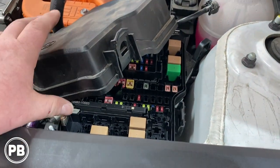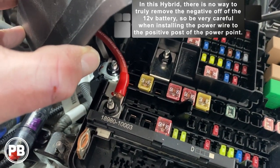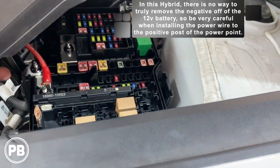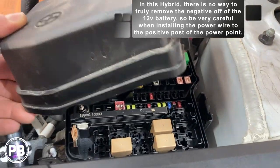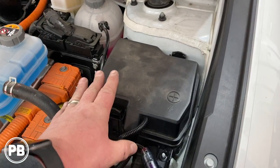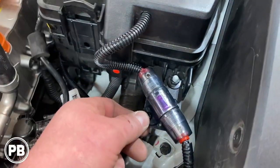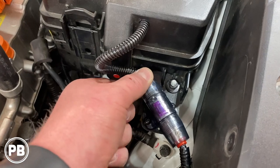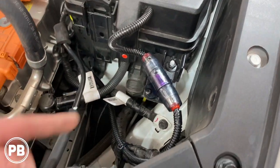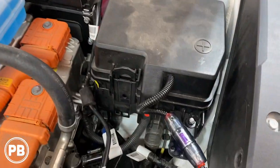With our power and ground hooked up on the amplifier, we went ahead and connected our power wire to the distribution area. We put just a small hole here with enough length that this can be moved up and out of the way, and now we can get this mounted and finish mounting our fuse holder. We got our power wire connected through that little hole, all split loomed, and made a nice little fuse holder. It's nice and sturdy — this is nice and short and then it goes split loomed all the way through the firewall as we showed you before. We're done underneath the hood.